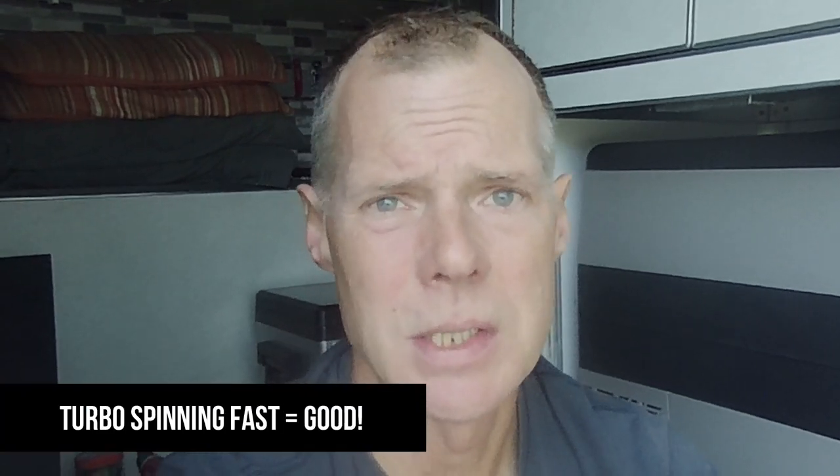That's not good, because I know from my reading and my limited understanding of diesel, bear with me here, that high exhaust gas temperature, EGT, is bad. And the way you keep those lower is by the turbo spinning at a higher rate. When you're in overdrive and the engine is really lugging and I'm dumping a ton of fuel in it because I'm going up a mountain and I really got my foot in it, the engine is really building up a lot of heat. This is my understanding, and it's bad. So clicking off the overdrive when I head into those steep climbs, that's what I need to be doing to keep that turbo spinning, to keep the EGTs lower. And I get better power too coming out of overdrive.